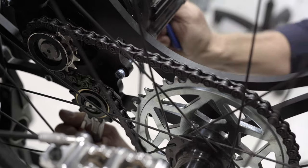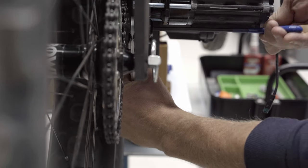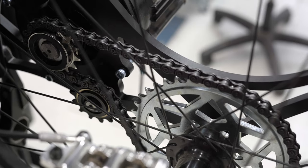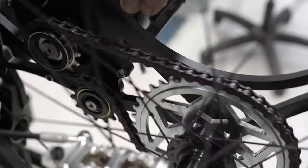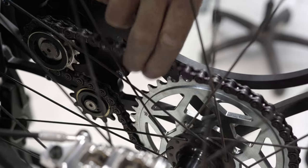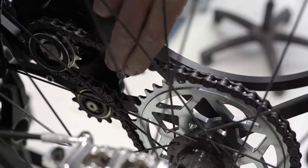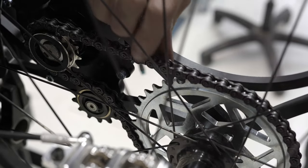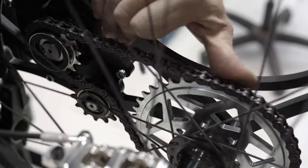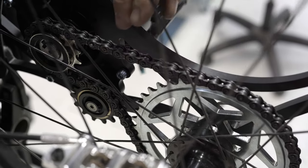So what we're going to do is at the tight point of the chain we're going to loosen it off, and then check it again by spinning the wheel around. We've confirmed it's not too tight at any given point in the rotation, and then at a loose spot we verify that when we push the chain sideways it's unable to come off those teeth. That's how we check our chain tension and confirm that it's good throughout.